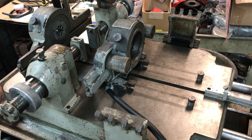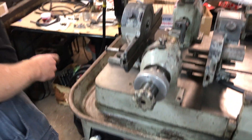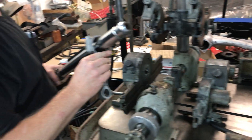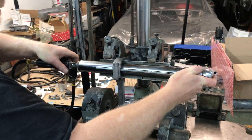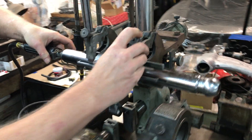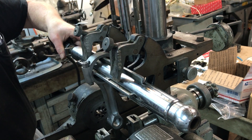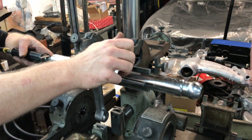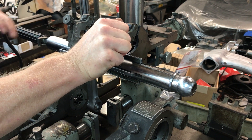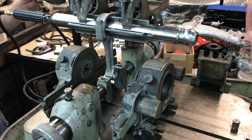What a person would do is get air pressure to the mandrels. You'd take a connecting rod, take the big mandrel and put it in here. These are really cool — they have a ratchet kind of thing on them so you can quick-release it instead of having to slide it through. You'd get that roughly centered in there, lock that down, and get the rod in a rough orientation.